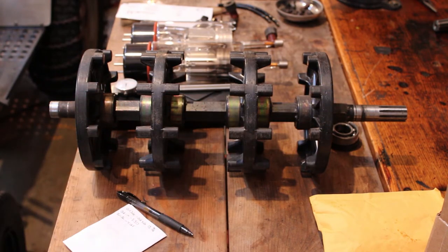I'm kind of debating right now what I want to do as far as setting the bearings. I think I'm gonna end up just driving them into their houses in the chain case and in the bearing retainer on the opposite side, and then fitting the drive shaft into the retainer and the chain case. I just think that's going to work out the best at the moment. Hopefully I'm not wrong about that. But that's how these custom builds go. Kind of just got to pick what makes sense, try it, and hopefully it works out. So I'm thinking that's going to be the next step.